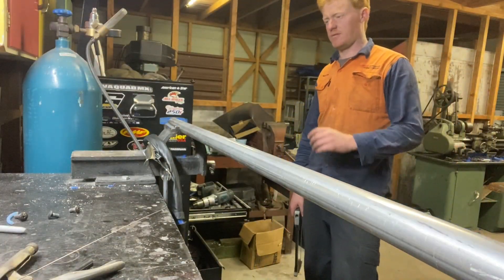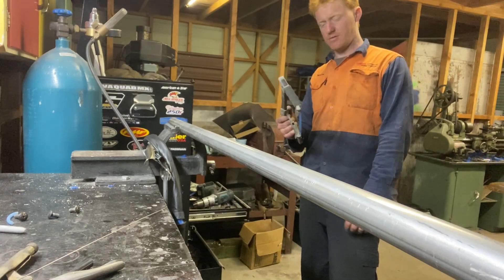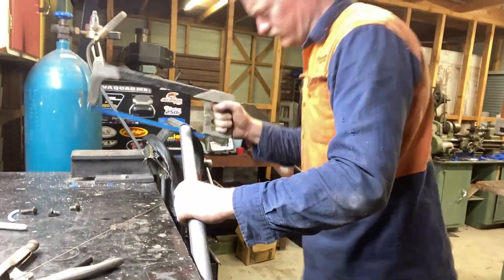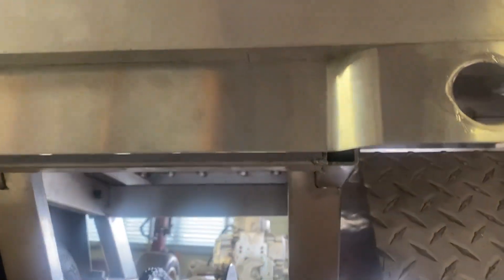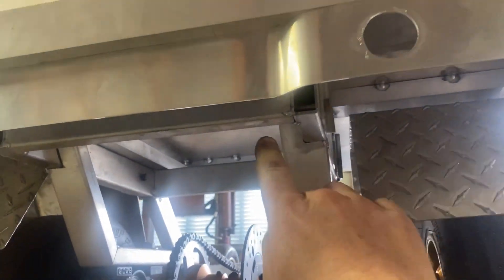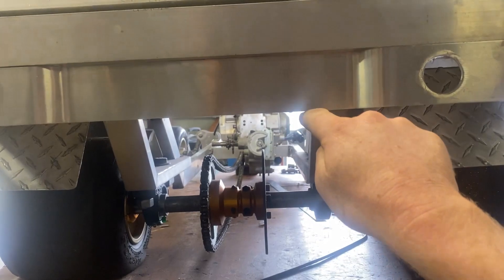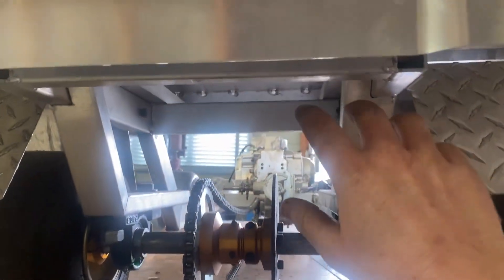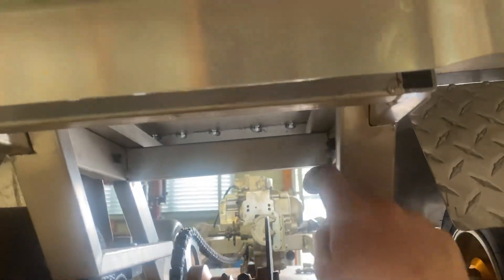So we've got it marked off there, I'm going to cut that. It is 10:30 at night — if there's one thing I hate it's annoying the neighbours with noise. So we're getting the trusty old hacksaw out. We're coming to the tailpipes — I'll do it a couple of ways. I'm going to run it down under these little cross members there, but I'm going to get all tricky so you don't see the exhaust sort of hanging here. It's obviously come down and gone under the cross members, but I'm going to come across out of both of them, scallop these cross members, make some sort of little exhaust hangers, then run it through there, drop it down into the front.